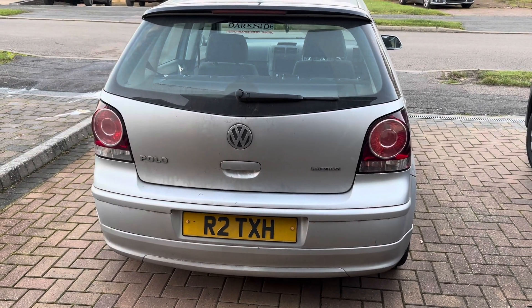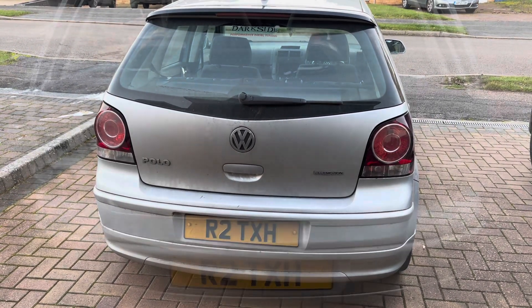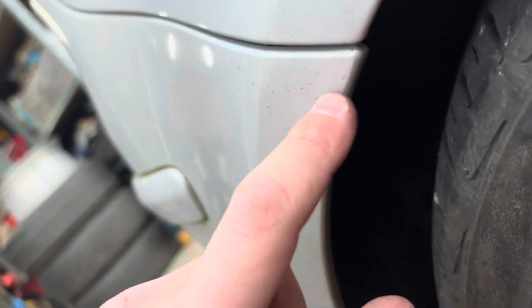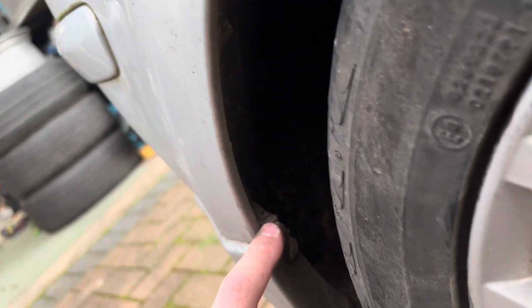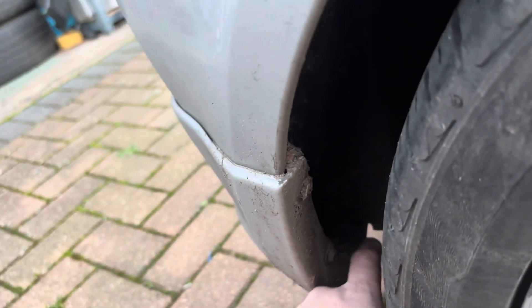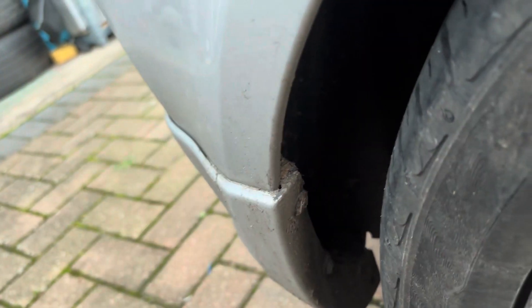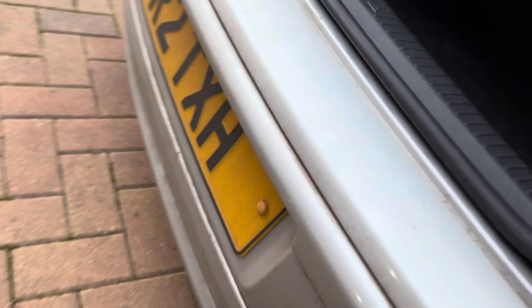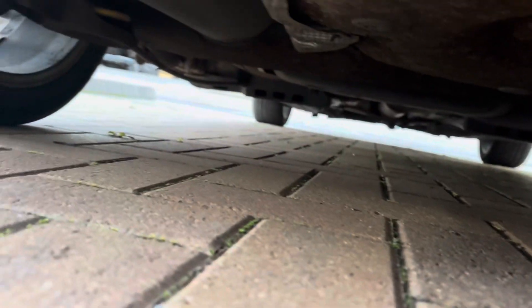If so, just pop four holes in there. To remove the bumper: pop your rear lights out first — there are two T30s in there. Then there are a few T20s and T25s down in the arch liner holding the bumper on, and a few more bolts along the bottom.